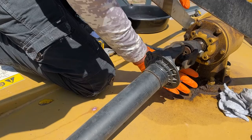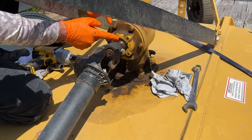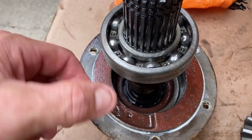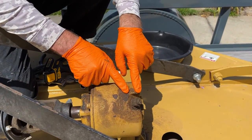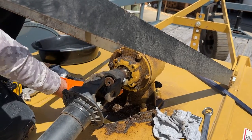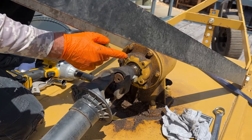You can see all this grease and oil here, this 90-weight oil, and this seal right here is leaking. In the previous video, we pulled all of this off and worked on it off the bench, but I think I can replace it while it's still on the brush hog. First thing I should do is remove this plug and remove some oil, but I've lost my pump. We're going to put a drain pan up under here, as we'll get some oil coming out if I can get that seal out.